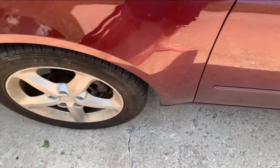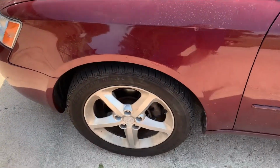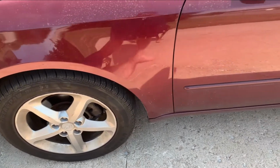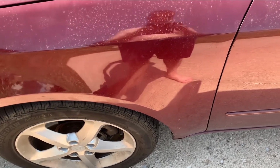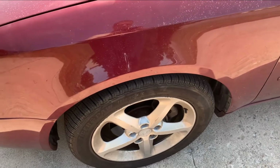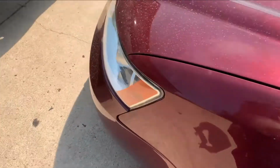It sits up higher on the left and the right. I don't know if you can tell from the video, but that's the non-collapsed ball joints and all that. The right height's back to where it should be. I do have to replace the tie rods that came with the kit, but I couldn't find my monkey wrench, so I wasn't able to take those apart. But this has been successfully completed on the left-hand side. Next weekend I'll do the other.